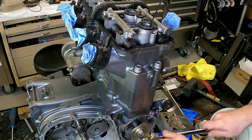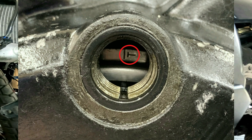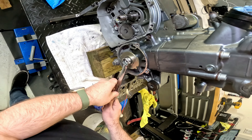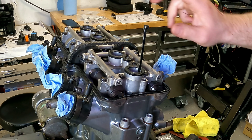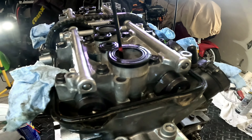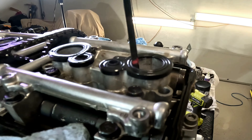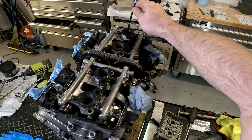The next step is to gain visual access to the ignition pickup rotor, or on some bikes you may need to use the timing marks on a stator rotor which is on the left side of the bike. My timing marks are on the right side of the engine. The timing marks will help us get the bike's camshafts in a proper position to take measurements of the current valve clearances. I'm also using a custom made tool — this long black plastic cable tie in the number one cylinder — to help me confirm when the piston is at the top of the compression stroke. By marking the cable tie with some red paint when I know it's at the right position, I can refer back to this mark. It's an inexpensive tool and a helpful hack when reassembling the valve train to make sure timing is exactly where it's supposed to be.